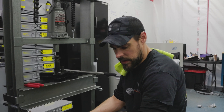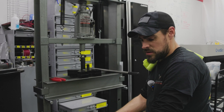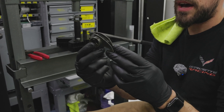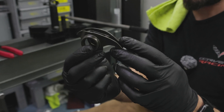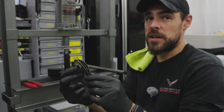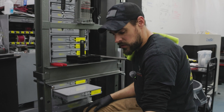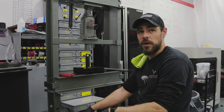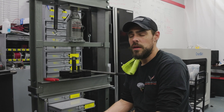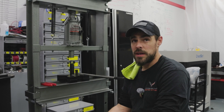It's also going to scatter the little needle bearings throughout your motor. I've dealt with this multiple times on LS and LT motors over the years. The reason you do the trunnion upgrade is it gives the rocker arm a further distance it can articulate — especially with a larger camshaft, maybe a little bit taller lifters. And it especially happens at higher RPM intervals.